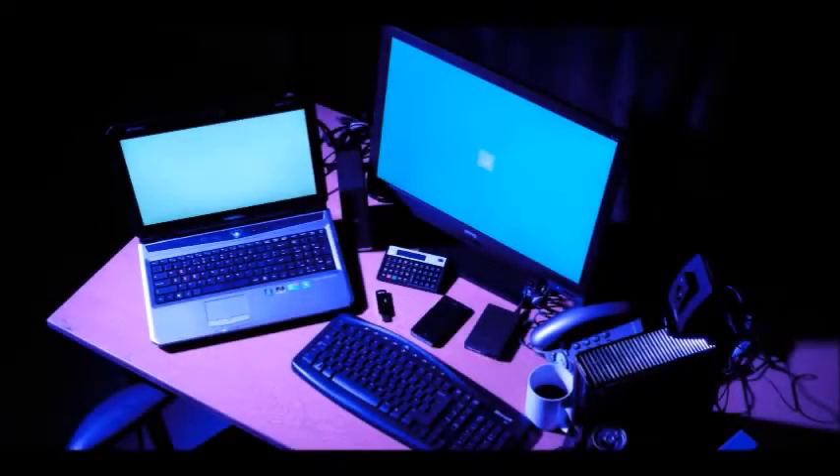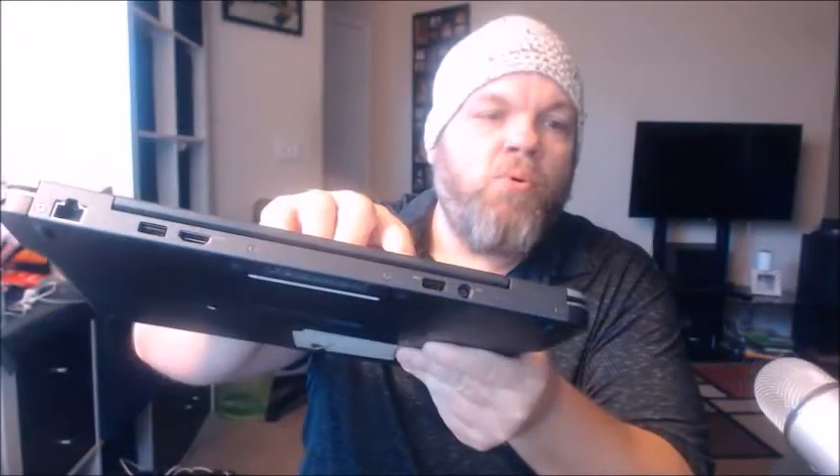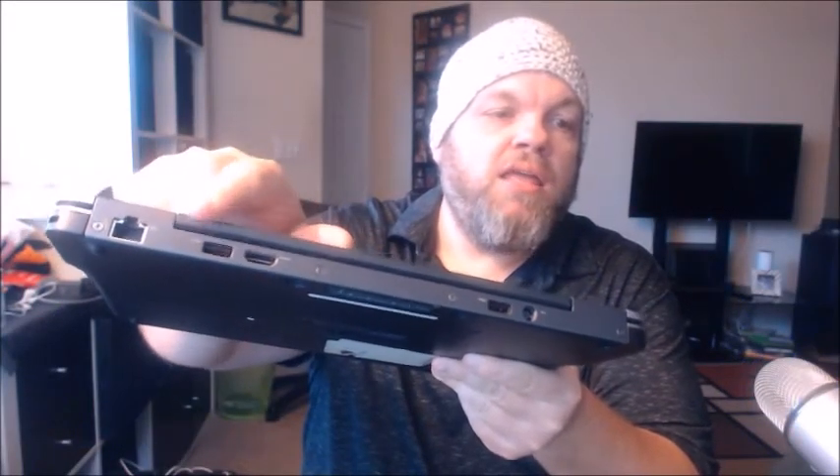You can connect your laptop to a desktop monitor or flat screen TV via HDMI or VGA if it's older. Here's the HDMI port — connect your laptop up to it. Older laptops and monitors will use VGA, which is old school from about 10 years ago. Some laptops will have VGA on the side. On most laptops there's a function key to connect to the monitor. On this particular Dell it's Function + F8 — hold down the function key and hit F8.